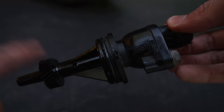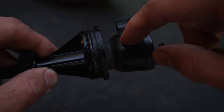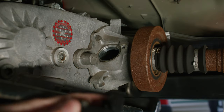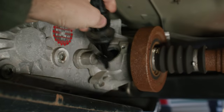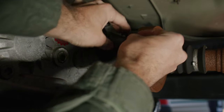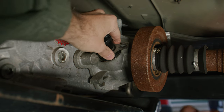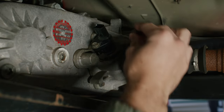Basically, whatever gear number you have — mine's a 29 — you rotate the housing so that the matching range, in my case 26 to 31, is facing down toward the ground. Insert it so that range is facing downward. Use the little keeper to guide you, rotate until it looks good, then push it in back and forth just like that, and put the bolt back in.